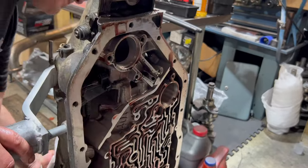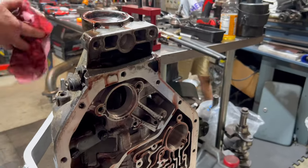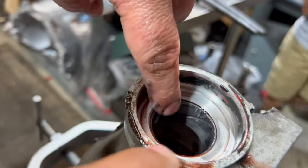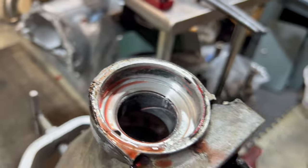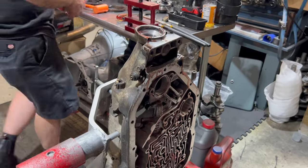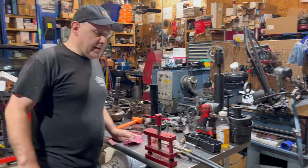So that's this one torn down. This is Mr. Wendell Sharpton's transmission torn down, and we're going to replace that bushing. Okay. Replace that with a Teflon bushing. So 204 teardown complete. Not a bad unit, even with that pump.